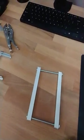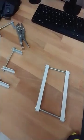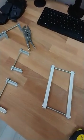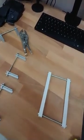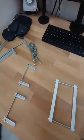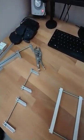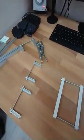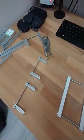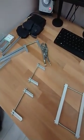This is basically the best solution. Even if you don't do the heatsinks on the back, this clamp mod will still help a lot. Adding heatsinks does even better obviously, but just by doing the clamps alone you get a significant improvement. If I had to choose one right now, the quickest fix is just do the clamps and it will lower temps considerably. If you want to go even further, add heatsinks and it'll be even better.